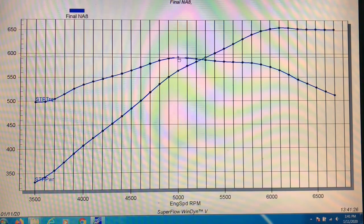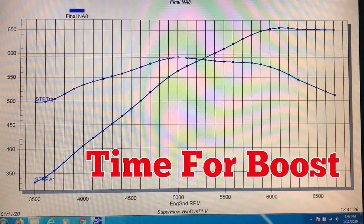This motor produced less power than I thought it was going to. It was a 427 with LS7 heads and that Brian Tooley Stage 4 LS7 cam, which we know has worked really well. This one was not performing as well as we thought, but not a big deal — we were going to add boost to it anyway. It had a decent torque curve, but when we add the ProCharger with a rising boost curve, it's definitely going to cure that problem.